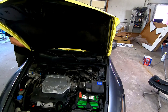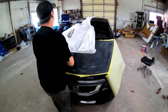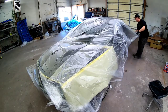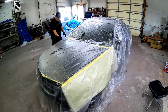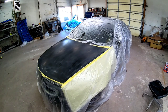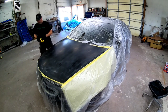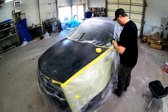Now we need to tape off this hood for primer. I'm going to back-tape the perimeter of the hood and get it ready for plastic. I started to put paper down on the tape but decided against it and just went with plastic — it'll be easier. This is an automotive-treated plastic designed so the paint won't flake off during the painting process; the paint will stick to it. You can purchase this at your local O'Reilly's or on Amazon — I have links in the description. I've cut out the area we're painting and taped down the plastic to the tape on the edge of the hood.